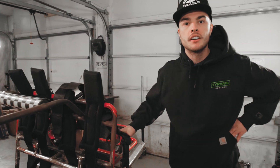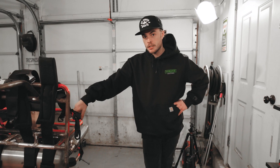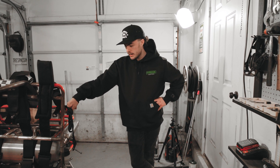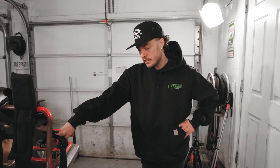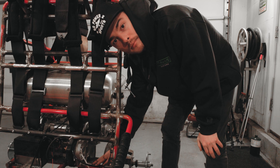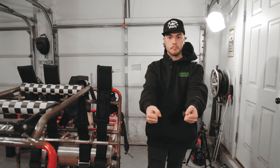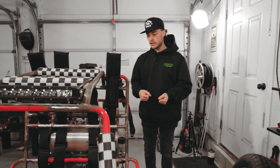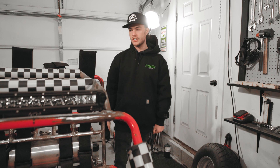So I rectified our issue. It turns out that I didn't have the alternator mounted backwards — I was just testing it improperly with my multimeter. I was getting zero reading, but what I found out is you won't get a reading unless there's some kind of load on your alternator. The problem was the alternator was hard mounted to the engine plate, and our chain tension is adjusted by how we mount the engine — the engine has four bolts on slides. So I pull the engine toward the back of the cart to tension the chain, and with the alternator installed that way, it wasn't going to allow me to slide the engine anymore.